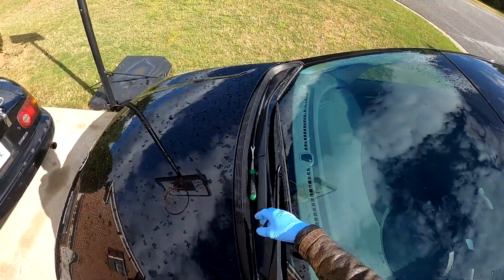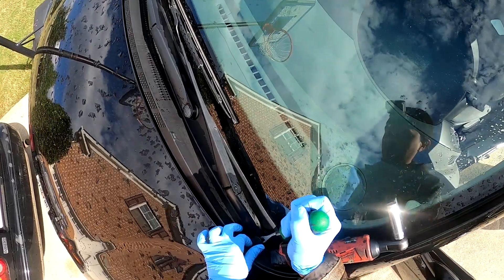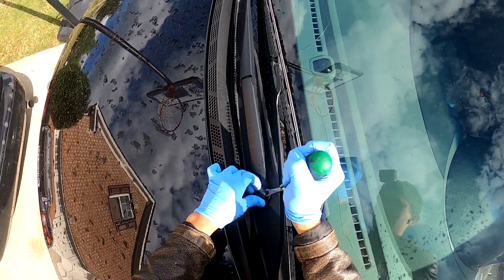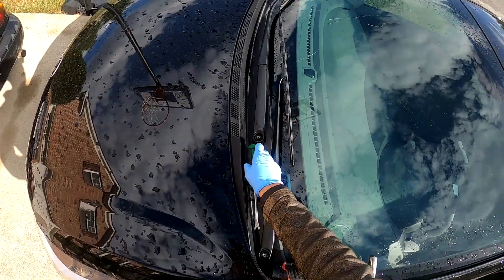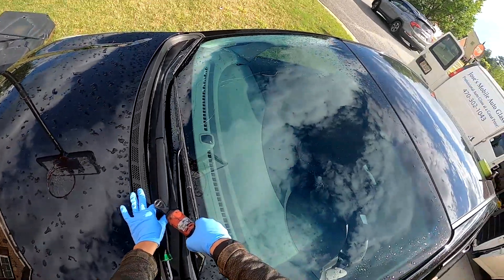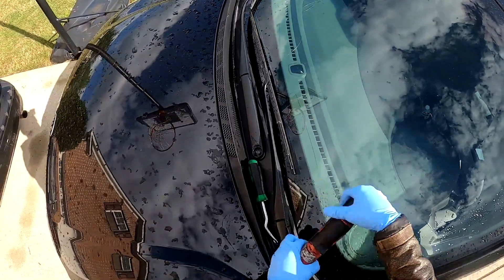The first thing you want to do is remove the wiper nut covers on the wiper arms. Using the pig's foot is the easiest way — there are little holes on the side that you can pry onto. Just pry them both off and save them. I typically pull all the nuts and plastic pieces into my pocket, then loosen up the nuts. I like to use my ratchet to take them off quicker.